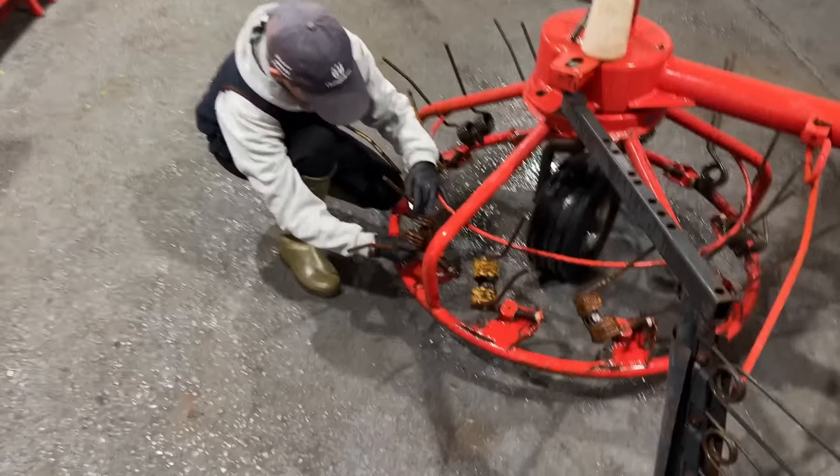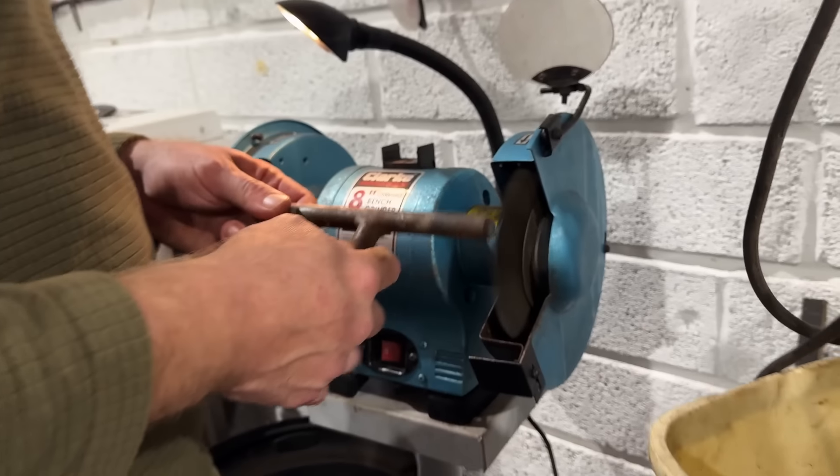We've got it free and greased up the shaft at the bottom. I'd have liked copper slip but I've got lithium grease. Now we need to grease the shaft at the top as well. Using the king pin in the wheel to hold it there - got the Milwaukee M18 grease gun. Love that thing, apart from the noise. One more little squirt there - ideal. Let's wipe that in around, then we're going to take the wire wheel to the pin to clean it up.